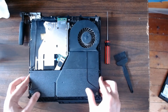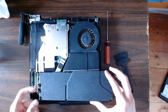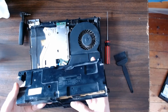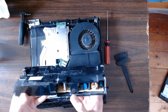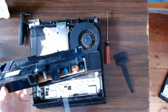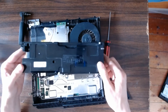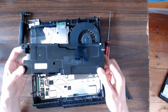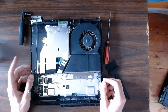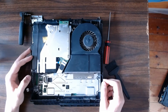Now you can go ahead and remove the power supply — it should just come out. The only thing is there's one cable still attached from the power supply to the motherboard, so make sure to disconnect that before removing the power supply completely. Now we want to clean off the power supply, and this is where the canned air comes in. We don't actually have to open up the power supply — we can just blow the canned air through the vents in the back especially. There was a lot of dust there, and we're not even close to the part where there's really going to be a lot of dust. There's no reason to remove the disk drive since there won't be much dust around there.